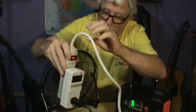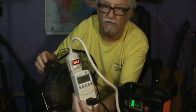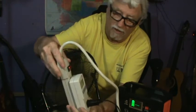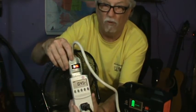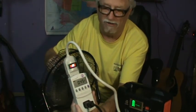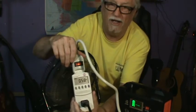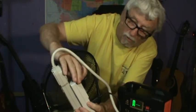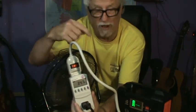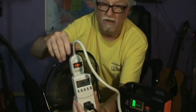Let's check it out — the fan is at low now showing 0.32 amps. I hope you can see that. I'm going to crank it up one notch to medium. Now it's showing 0.45 amps. Let's go to high now. On high it's 0.59 amps — that's about half an amp. That's 34 watts out of my 200 watts — that's what it's pulling at high speed. Pretty good!